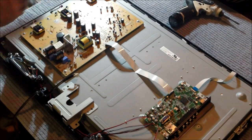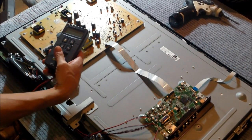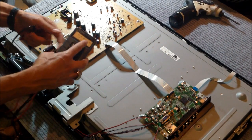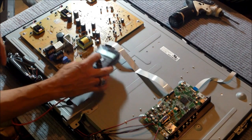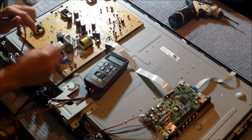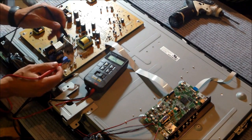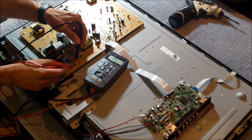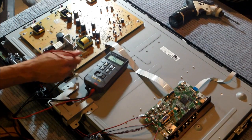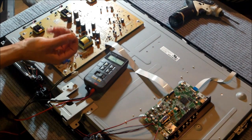Let me find out using my Fluke 12 multimeter — you can't get this anymore because it's 10 years old, which makes it an antique. So you want to put it in continuity mode, which is diode mode. The fuse is bad, or else I'd be hearing a short signal. Let's pop that sucker out. Make sure you unplug the power — unplug the power. Let's get a fuse.